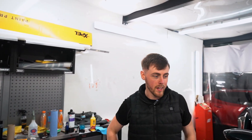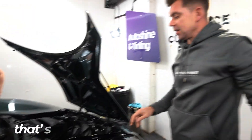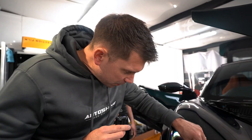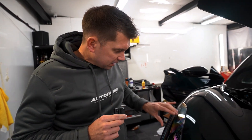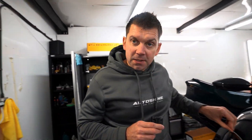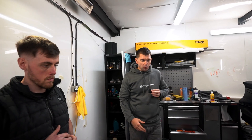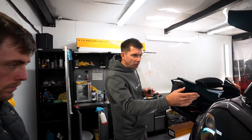I think I may have just found how to open that - there you go. That's what's under the mirror bonnet. The wings are on but they can be better. The PPF is along that line there, but if the headlight was out we could wrap into there. We take the wheel out, undo the clips around the inner wheel arch, take the headlight out, and that allows for a better PPF. We don't normally take stuff off vehicles to fit PPF because that's the idea with computer cut, but all in the name of good PPF - we will modify the patterns, take these off and fit new ones.